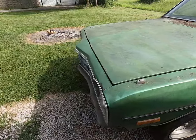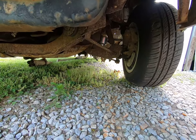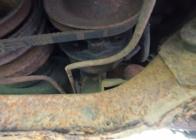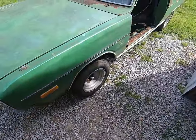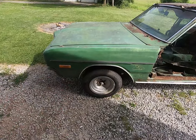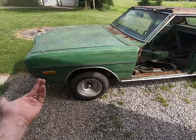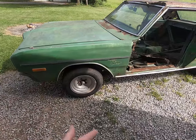The main reason I bought this car: if you look underneath here, '73 and up models have a big bolt pattern — like the big B-bodies, E-bodies, C-bodies — and you've got disc brakes. You've also got a K-frame with the spool mount motor mount situation. In my opinion, that's a much more superior design over the rubber biscuit mounts, which are kind of fused together and could fail. It's just a more secure situation. The disc brakes are better than the earlier ones — they're a single piston; the earlier ones were like a four-piston. Plus, the '72 and back disc brakes are really rare to find. The '73 through '76 are very common.